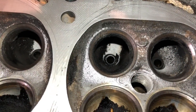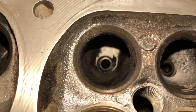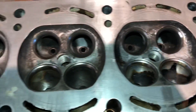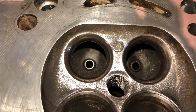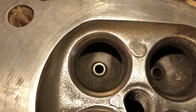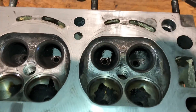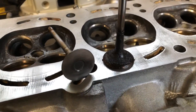Just don't even bother doing it with the head on. I've got all the kits to do it with the head on - it's just not worth it. Take the head off, rebuild it, lap the valves back in - you get far better compression, you're gonna make far better power. All these people trying to make as much power as possible with ports that look like that, shoving big turbos on them and not cleaning up the ports - there's just no point.